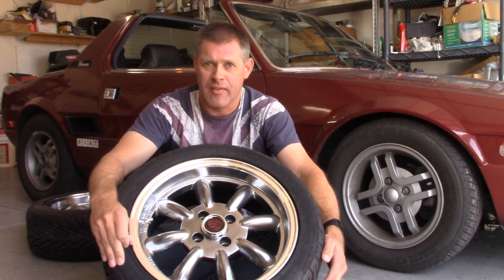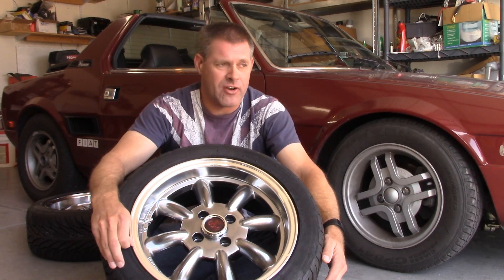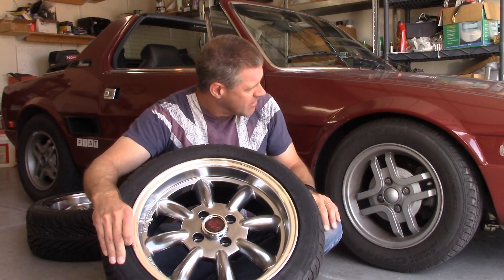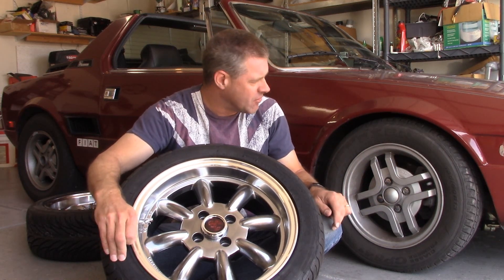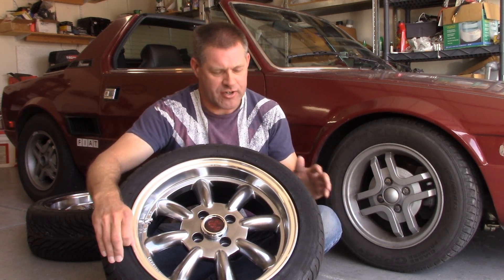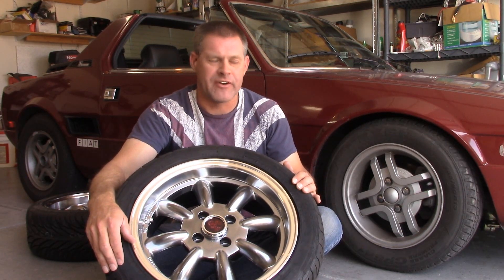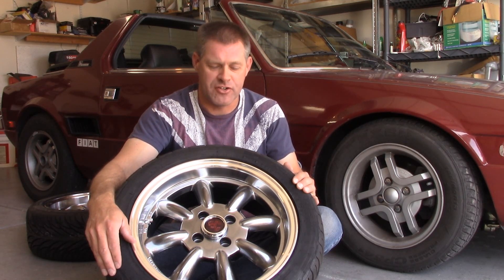It should work really good on the back of the car. On the front of the car I'm not so sure, because it's lowered quite a bit as you can see here from where it was at the factory location. I've heard these tires will fit — they say if you go with a 195/45/15 that's about all you can clear, and we're going to find out because I really want to put 205s on this car eventually.